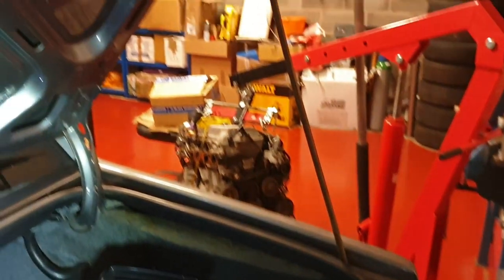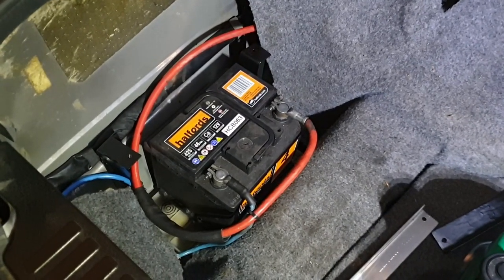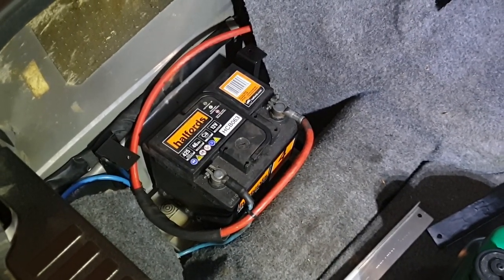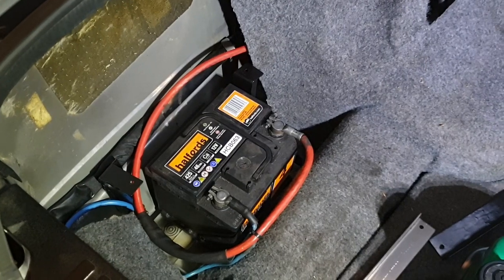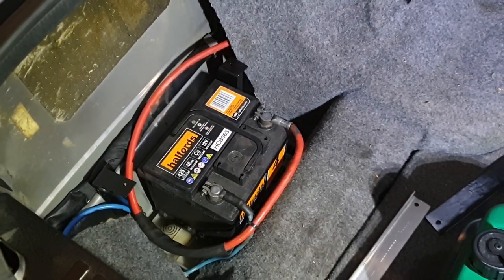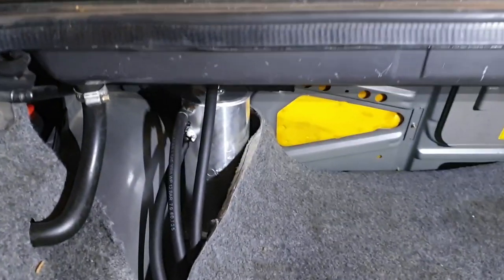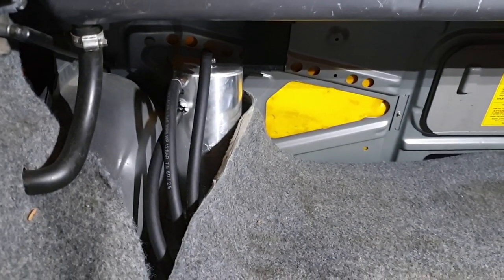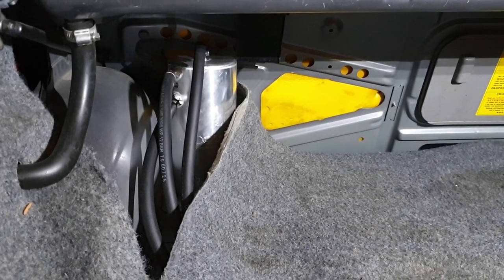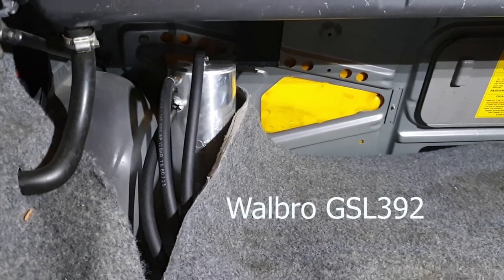I have a nice stick holding up the boot lid there. Eagle-eyed viewers will have noticed the battery is not in the front — it's relocated back here on the left. There's a recess in the boot which is perfect, great size. The original plastic battery tray is sitting underneath it, and I managed to make brackets that hold it down without using any new holes in the body, so I haven't had to mess up the original bodywork at all. I also have a swirl pot in the back. I've kept the original Volvo lift pump — this car had two pumps — and I've just upgraded the inline pump, which is a Walbro GSL something-or-other, and hopefully that'll do the job.